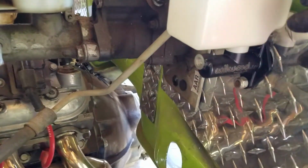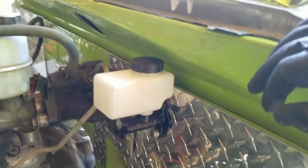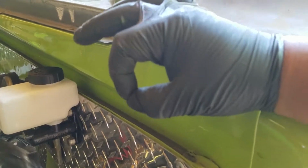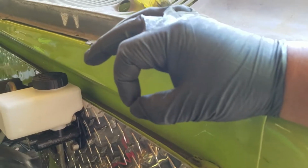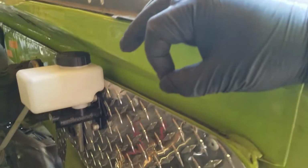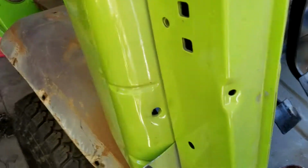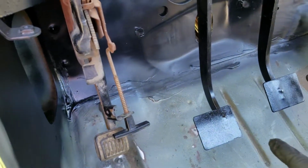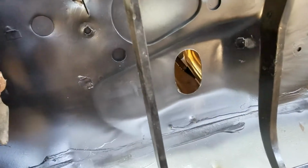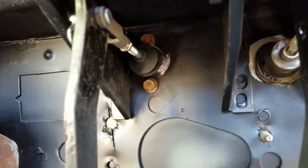Another problem that I had was that I went a little bit too big on the hole saw. Not too much on the actual hole saw, but the problem is that when you go to use the hole saw, it'll begin to shake, and you'll probably go about 1/8 of an inch too wide. But that's just standard. I was aware of that, but from where I had to go buy the hole saw, they went from 2 inches to 2.5, so there was no in between to take up that space. Another thing where I messed up was that it's not perfectly centered right there.